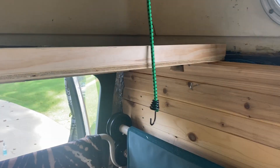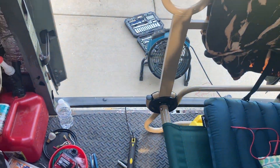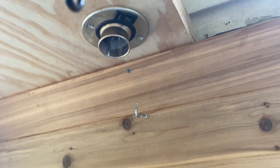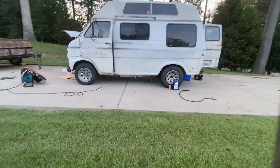It has been determined that there were some wiring issues with the old connectors. We've at least got the lights installed — they were running for a second but it was going to be a fire hazard, so they're not plugged into anything right now. On the flex fan, I've got to get a longer bolt — one inch longer since I'm putting in a one-inch spacer. We're going to the supply store in a minute to do that.